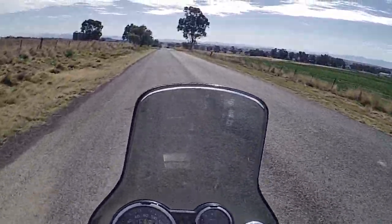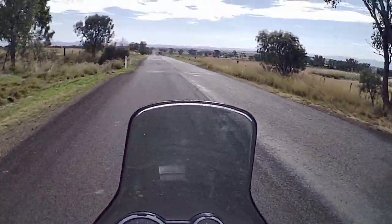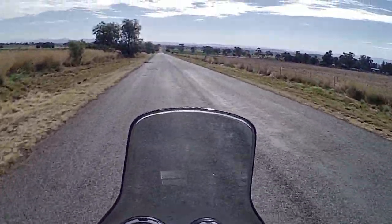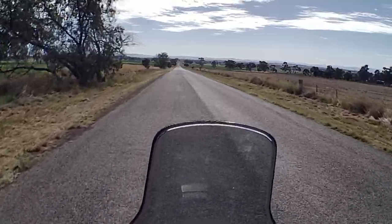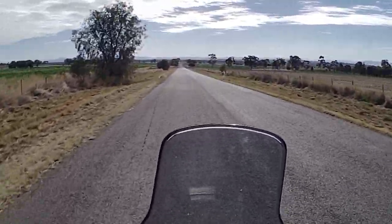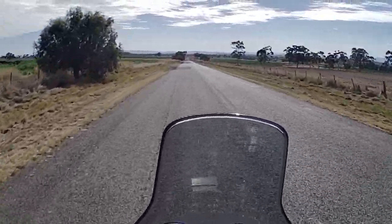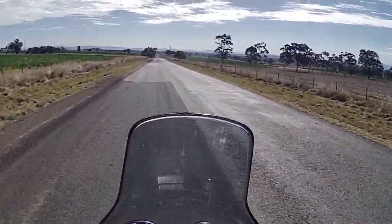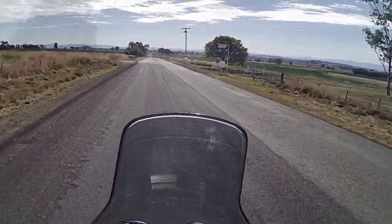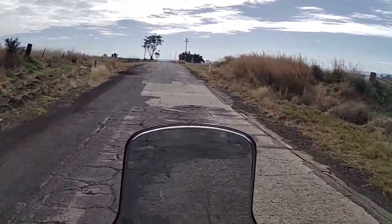That's an interesting feature of the Himalayan — I certainly don't have that on the postie bike. If you start the bike up, put it in gear, and the side stand's down, it'll shut the bike off. It obviously doesn't want you to ride off with the side stand down. On the postie you've got those little rubber feet that are an extension of the side stand, so at the first corner the rubber extension hits the ground and flicks the side stand out of the way. Not so with the Himalayan. Luckily it has a warning light on the dash that says the side stand is down, so I was quickly able to look at that and fix it up.